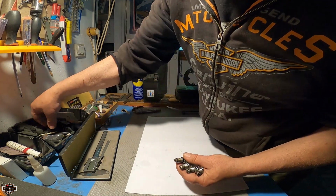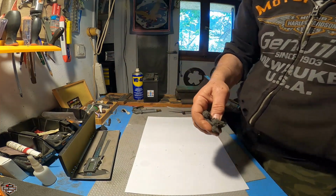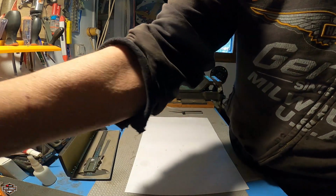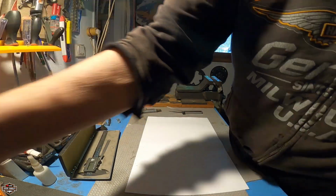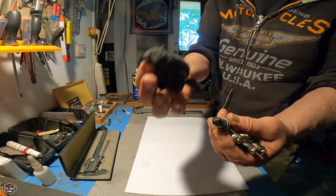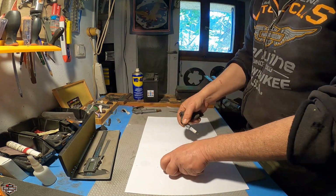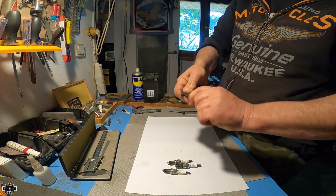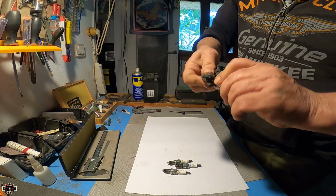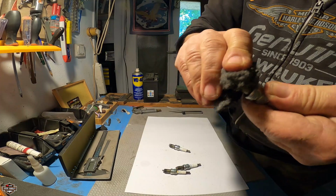And that was a low one. I remember which one it is. Alright, so to clean them, I'm gonna use 4-0. Alright, don't use something like that on the spark plugs. You probably destroy them. Okay, so I'm gonna use these. Again, this is 4-0, it won't damage nothing. Alright, and that's how I'm gonna clean them. And after I clean them, you see, look the difference already. You don't need to do too much, just a little bit.